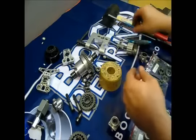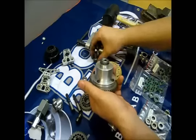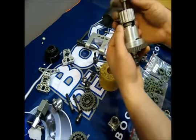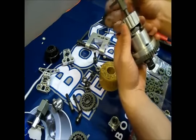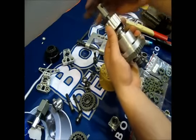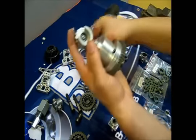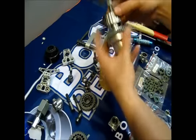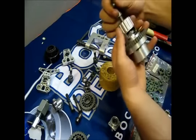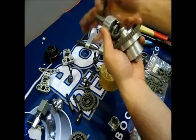And finally, the diff. Remove one drive cup from the diff, put the bearing removal tool on it, and carefully turn it clockwise. Okay, here it is — one bearing removed. Now let's go to the other side. It depends on the diff and the case how hard the bearing went on — that's how hard it will come off. These bearings are coming off pretty easily.